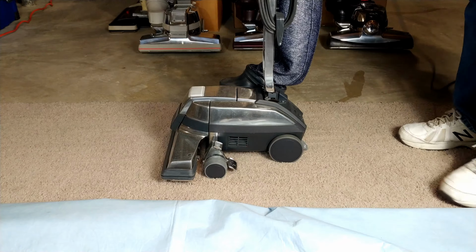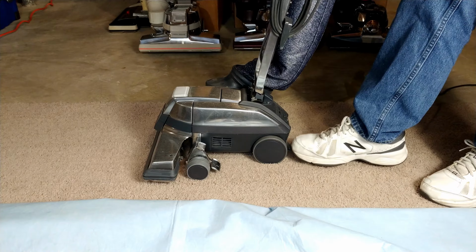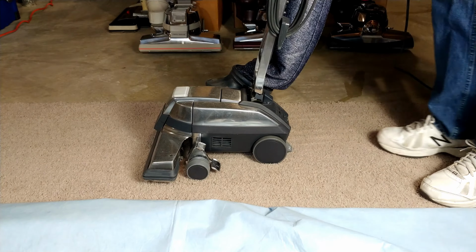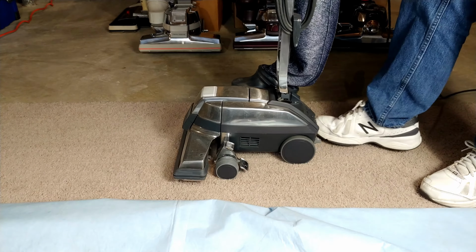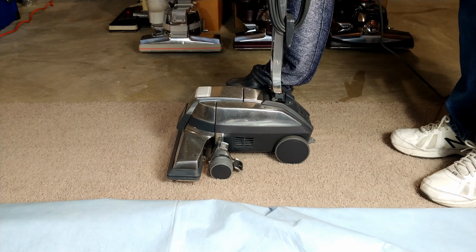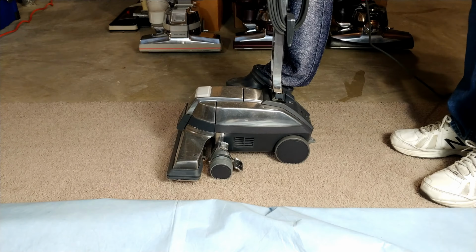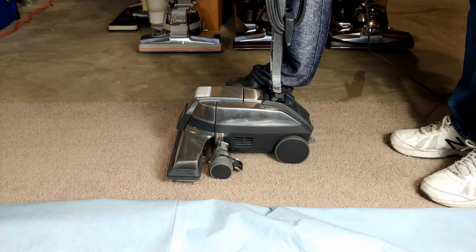So I got the transmission in neutral. Maybe let's grease up those rear axle bearings. That's one of them. Here's another issue. That is excessive wind down time. So that's going to mean front and rear motor bearing.